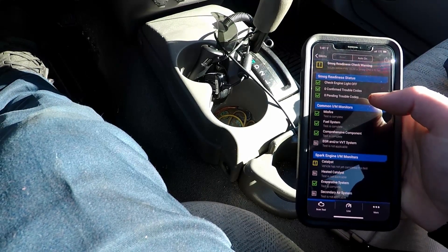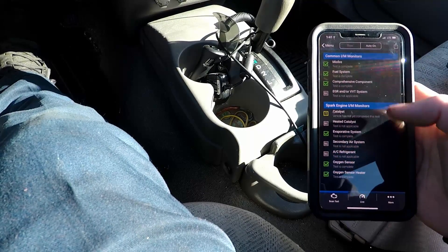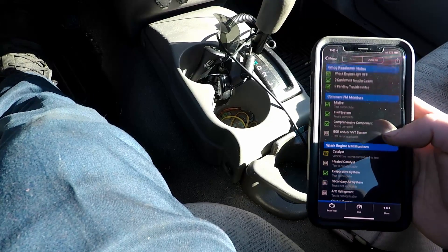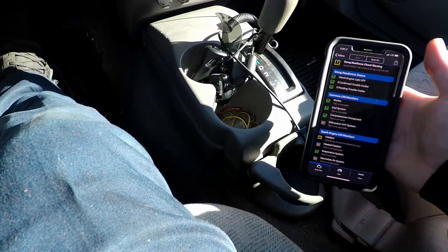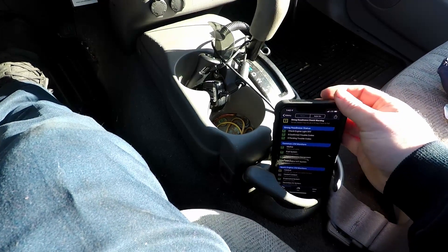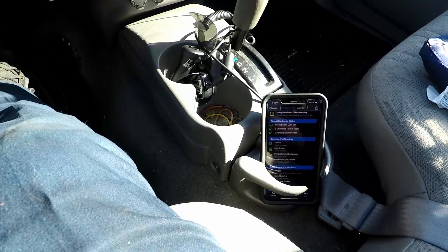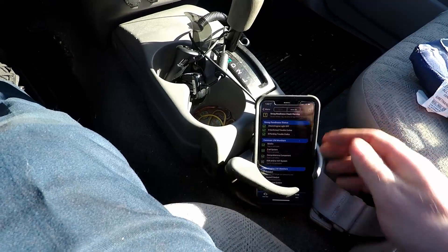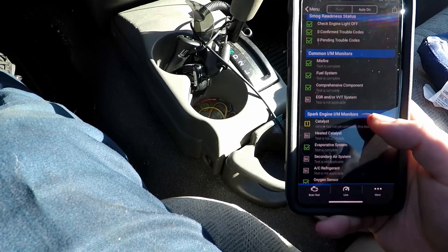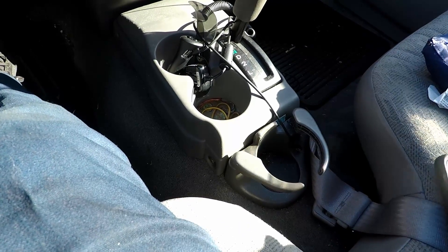What I like about it is that I have my pending codes as well as the check engine light and all of them, and they update automatically while I'm driving. So if a pending code does set on something I haven't worked on, or the customer just hadn't been driving it right, or the dreaded scenario where they don't tell you at all that there's an issue and they just cleared the codes before — I can see that on the same screen, which makes it really nice.